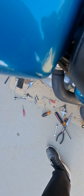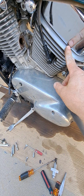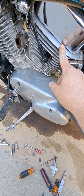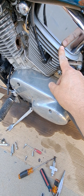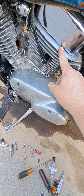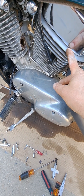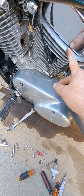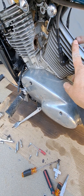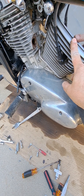This cylinder right here was cold because it's running lean — it was basically being starved for fuel. That's what the mechanic was pretty sure was the problem. He told me to take off the carburetor bowl, which is right here — it feeds this cylinder — and make sure it's clean, not plugged or fouled up. Make sure your jets are clean.